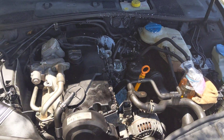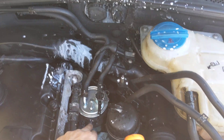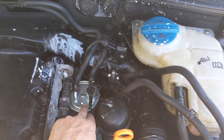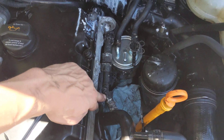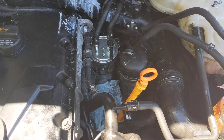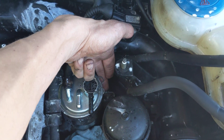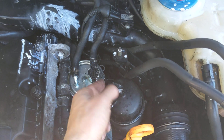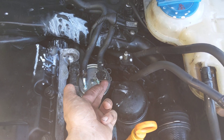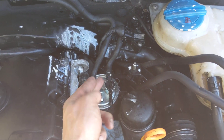This is what it looks like under the hood, on mine at least. I just replaced this fuel filter, put a new one in. See this line? Don't unplug it — coolant runs through here. I sprayed coolant out on here. To replace the filter, there's just a 6mm Allen on the other side and you can pull it out. Careful when you pull this pin out — you don't want to lose it. You might even want to tie a little string or rope around it when you pull it out. I dropped mine.